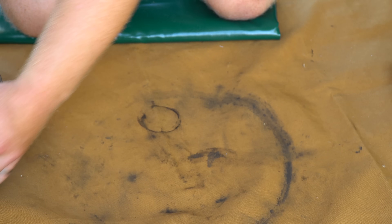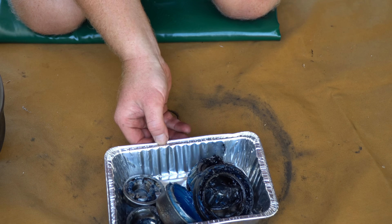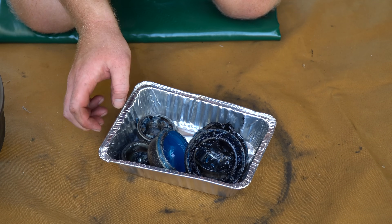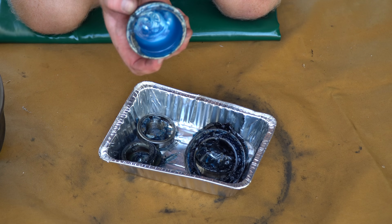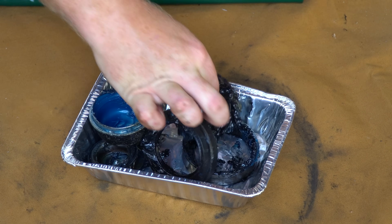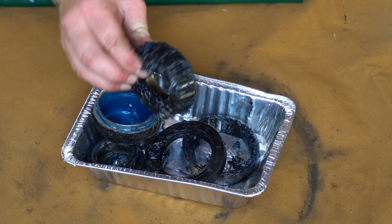The inner cups are now pushed out of the drum assembly. I've taken some degreaser to it and cleaned up all of these inner surfaces so we have a really clean and fresh mating surface for the new cups with the new bearing set. Looking at the old bearings, we can see they are not that nice blue grease they were when they were first installed — they're quite black and dirty, which indicates a very worn out old bearing.